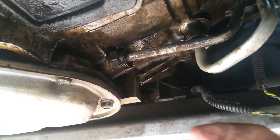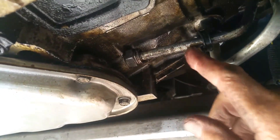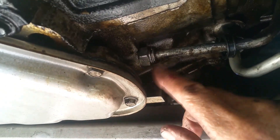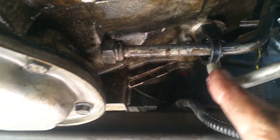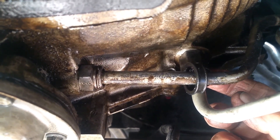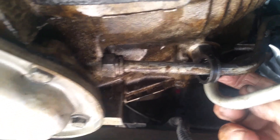I've already repaired it. I should have showed you how to do it, but these cooling lines have a little spring lock on here. There are two of them — one right there and one right over here. It runs off your radiator cooler down here to the transmission.